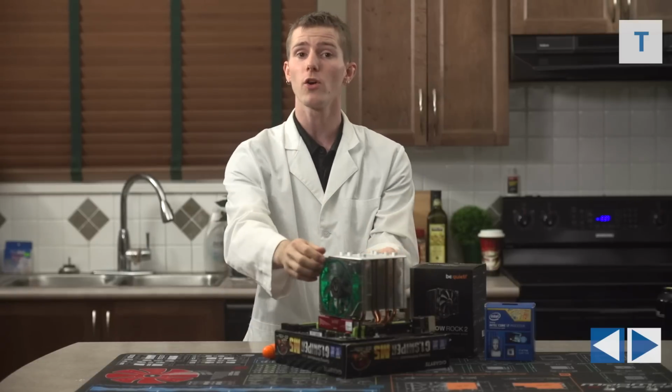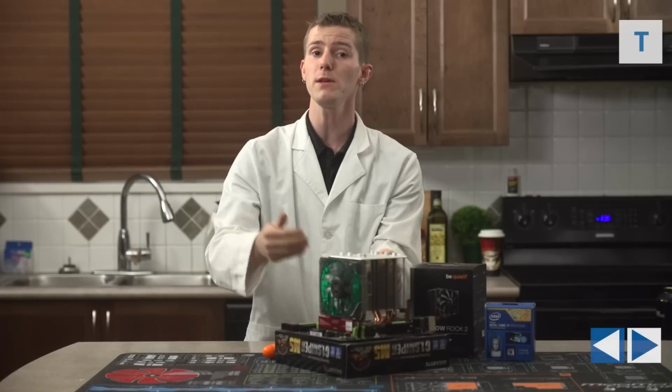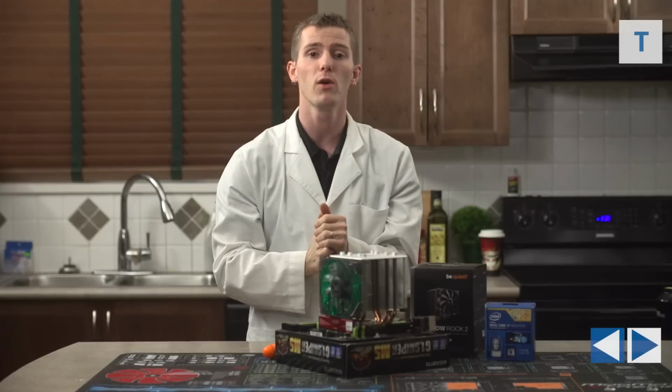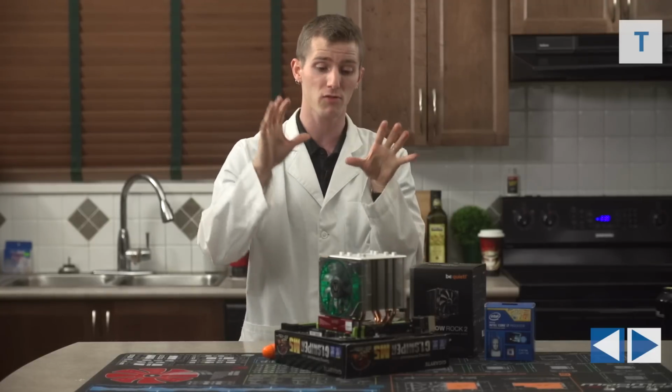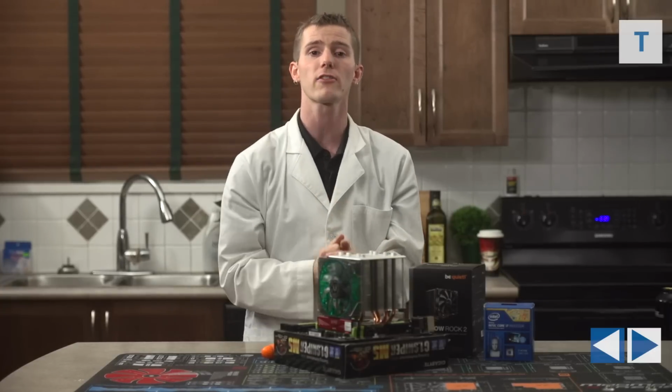Also, don't forget to orient the fan when you're installing it so that the power lead reaches the CPU fan header without any extra cable mess lying around all over the place. Solid cable management starts at every step, making sure that you're maintaining it. So you can actually plug that in now.